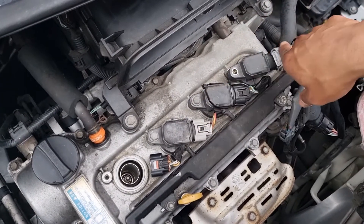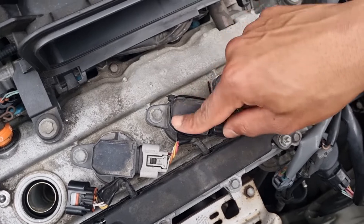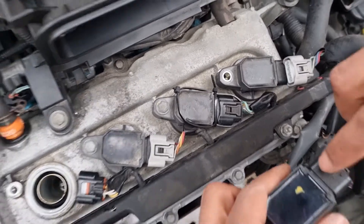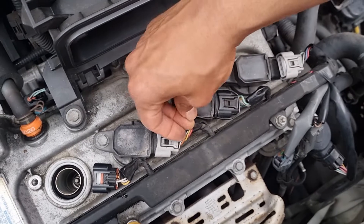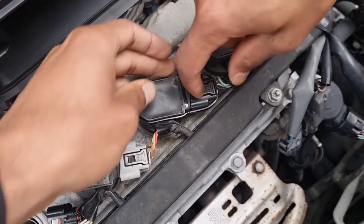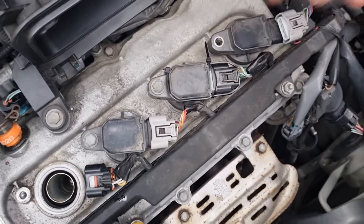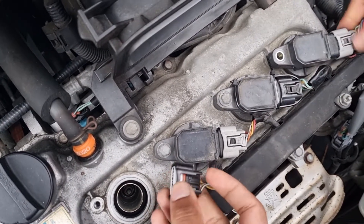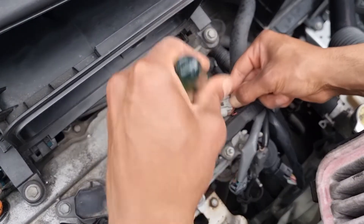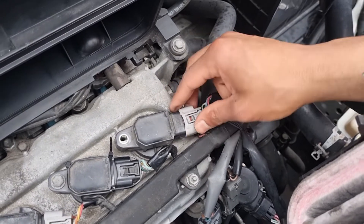This customer didn't want to rewire all the connectors, so what you can do is follow this procedure — a cable tie around this part, and then a small cable tie holds it onto the main coil pack in that little groove. When you want to secure it, it's secure in there and there's no chance of this plug popping up. If your top part breaks — the clip which holds it in — you can just follow this method. The right way to open these plugs, especially when they're old, is to assist it with a small screwdriver and give it a wiggle.